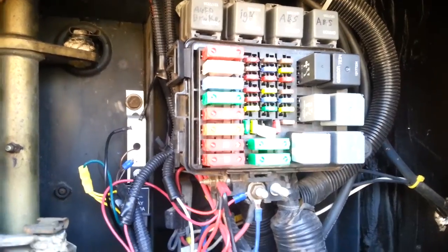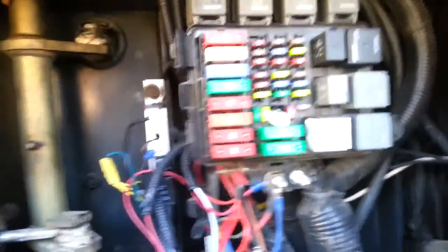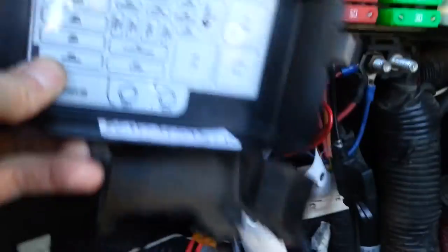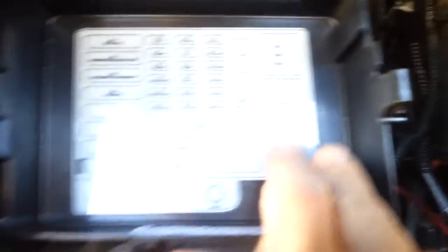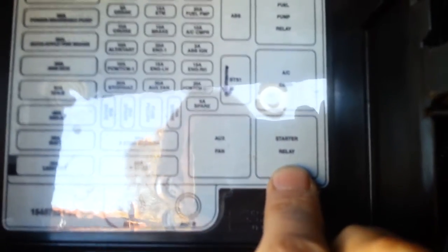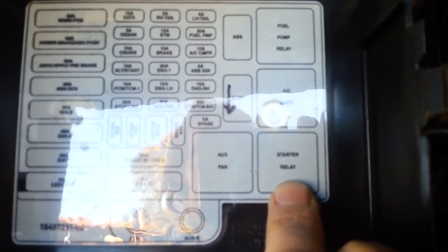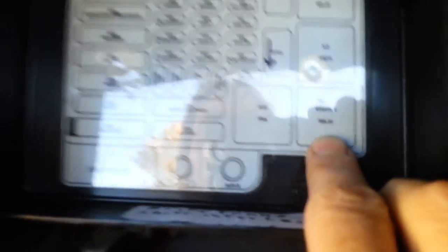I had the wife go in there and said, you turn over the key, let me go right here on the firewall and check the starter relay. In case you don't know, take your cover off — there's your starter relay. And if you have a no-start condition, that can happen: all the lights are on the dashboard, everything looks normal, and you turn the key all the way over and nothing but silence. That's the first thing you want to check.